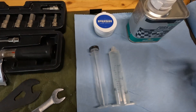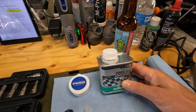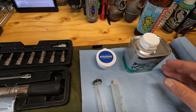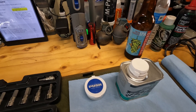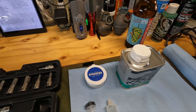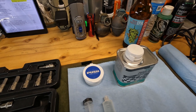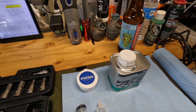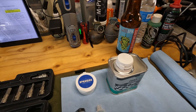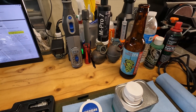You'll also need a syringe and some kind of oil. They recommend 20 weight; I'm actually going with 10 weight. And then you're going to use Slick Honey — I'm using Push's SOS grease, which is pretty much the same thing. One interesting thing about this kit is it uses 110 milliliters of oil on the coil side. The Push kit, which I have on my other bike, has only 20 milliliters — so that's a massive difference. Reminds me of the old Marzocchi Bomber forks.